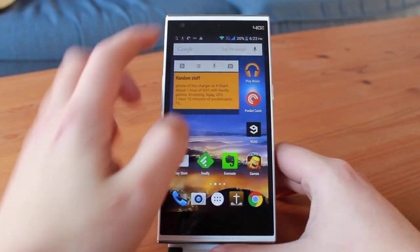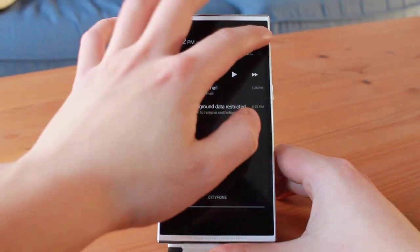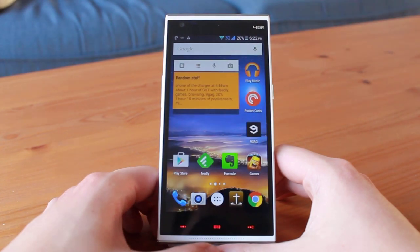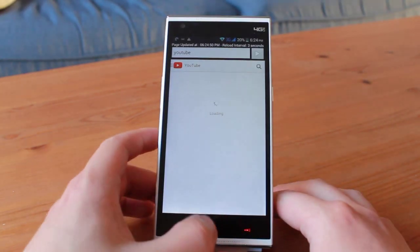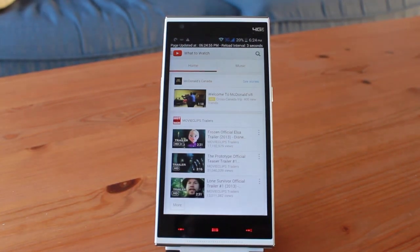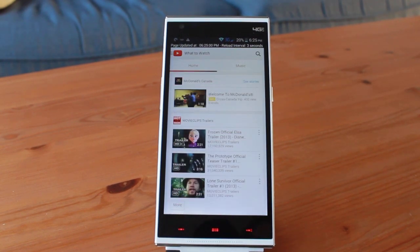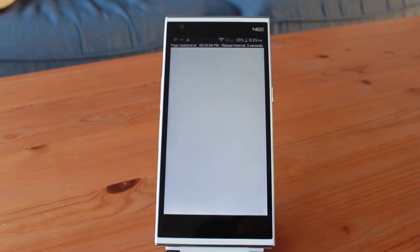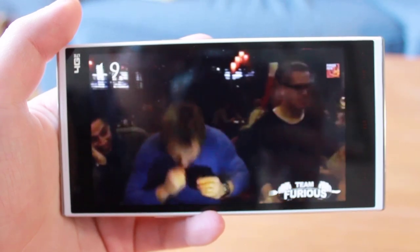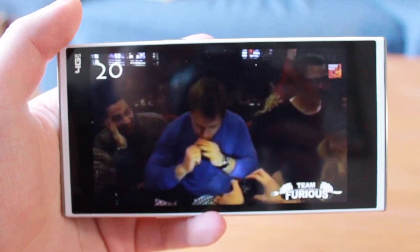Because the Kingzone N3 Plus has such a large 2800mAh battery and a smaller 5-inch screen, I was hoping for absolutely amazing battery life. I performed the web browsing test and the video test. I set the screen brightness to 250 nits and used Web Reloader from the Google Play Store to reload web pages over WiFi every few seconds. The Kingzone got a whopping 4 hours and 40 minutes, which is absolutely terrible for such a large battery. In the video playback test at 250 nits, a standard definition video was played and it got 5 hours and 22 minutes, which is a little better.